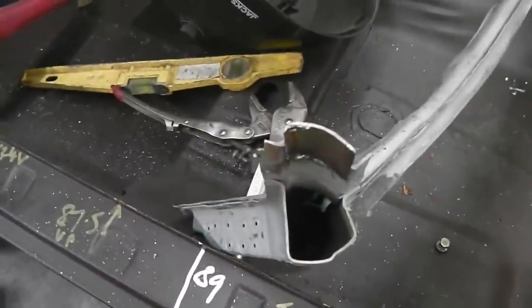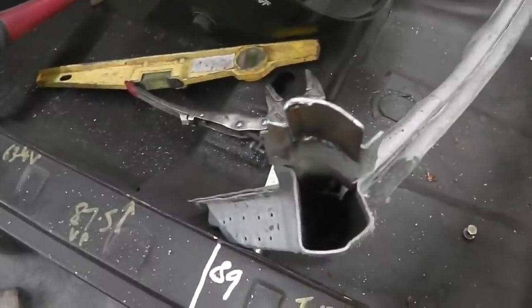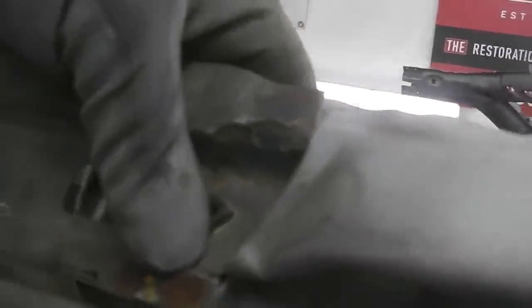Here we go. Nice one. We'll slot this in now. So we fill it both. Okay, this is where we use our jack now to jack up that back end till this closes up. You'll see it close up as I operate the jack. Oh yeah. That gets us now, starts to clip together, and that's just slotted in as I put the tension on it, and then we look for the door gap coming back in.